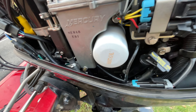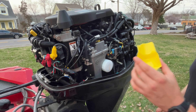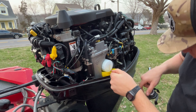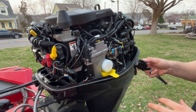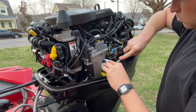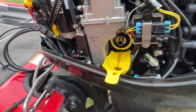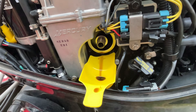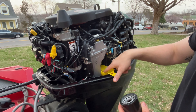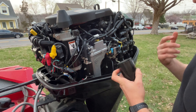When you replace the oil filter, do your best not to let oil drain into the bottom of your engine — these engines are really clean and you don't want to get anything dirty. Take your drain tool and fit it right in there so any oil from the filter won't go into the bottom of the motor. Then take your finger, get a little of the old oil on it, and rub it around the seal on the new filter. The reason you do this is so that when you're twisting it on, you don't accidentally peel the rubber seal off your oil filter.